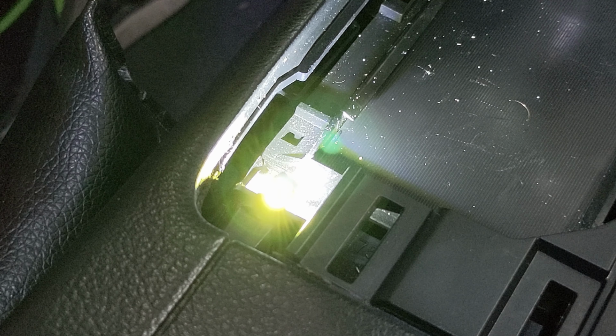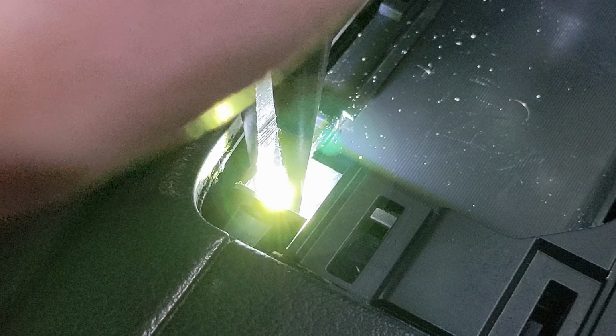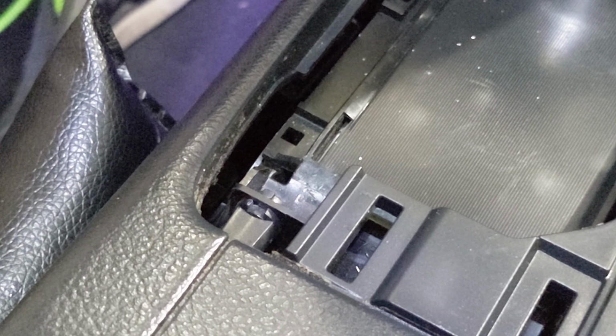After reviewing that last footage, I realized that my hands were blocking your view, so I have the camera up nice and close. So again, grab your tweezers. We're gonna grab the sides. And we're just gonna wiggle it out, and we're gonna pull out. Just like that. We got our LEDs, and same thing, we're just gonna plug it back in. So I got it held there, and we're gonna stick it in the socket, making sure I have everything lined up. And there you go.